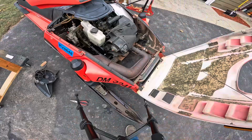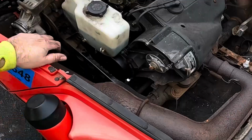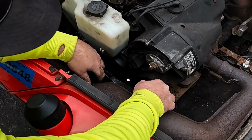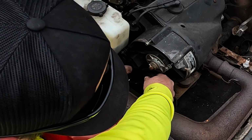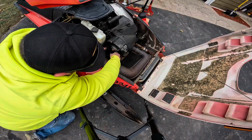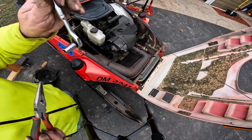So I'm gonna try and tape this the best I can, but basically this is the frame and this is the motor, and without pulling the motor, somebody with fat hands like me, the only way to do it is a pair of needle nose, grab the socket that holds you in place, gets you started threaded. And then you can crank where you're at. Little tip for you. Anyways, you get the idea.